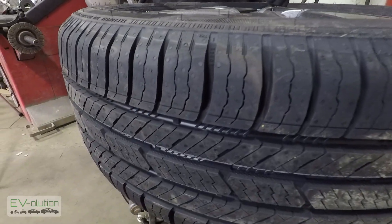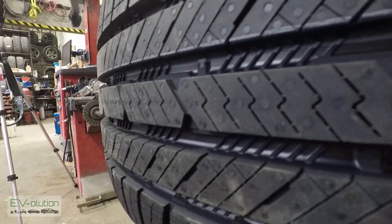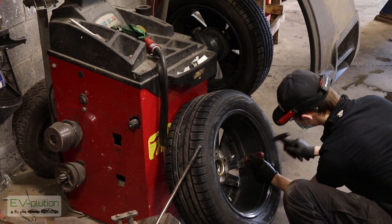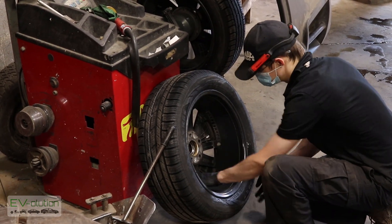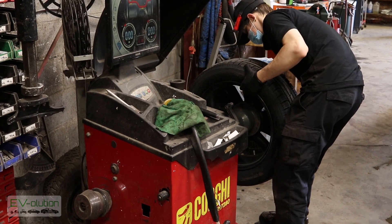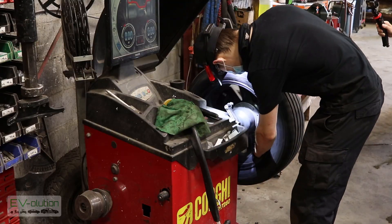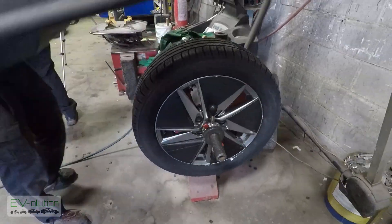Here's a nice view of what the Nokian 1 tire tread looks like — it's quite deep and should do well in the rain. Like with any modern car with mag wheels, the weights used to balance the tires are stick-on weights placed inside the rim, as opposed to the old lead weights clamped onto the outside edge of metal wheels. The old weights are removed, the residue cleaned out, and then the wheel is put on the balancing machine to measure where new weights need to be placed on the inside.